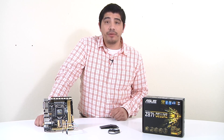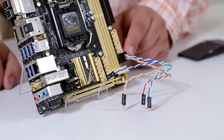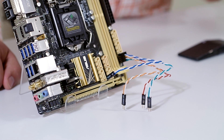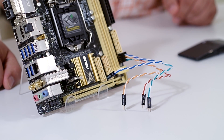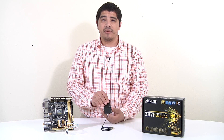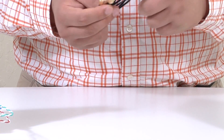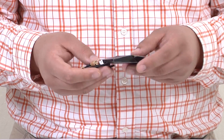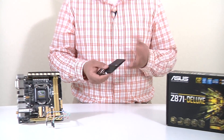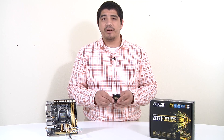The Q-Connector is an extension cable that runs to the bottom left-hand side of the board, allowing you to more quickly connect all front leads such as the power button, HD LED, and reset - much easier than routing through the tight block area directly on the motherboard, especially in confined Mini-ITX chassis. The antenna has a redesigned flexible form with different positions and a magnetic base. The connection fittings are SMA-based, giving you flexibility to upgrade to a higher amplification DBI antenna if desired, though these offer solid signal strength by default.